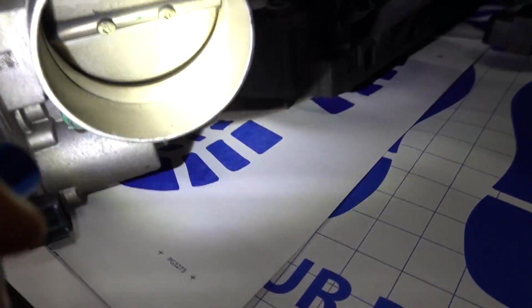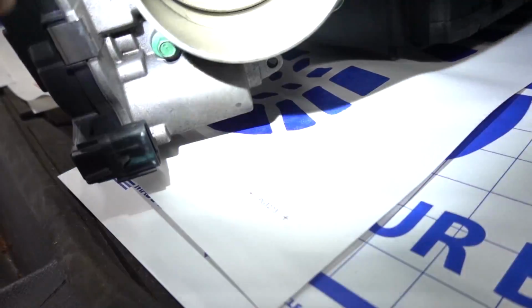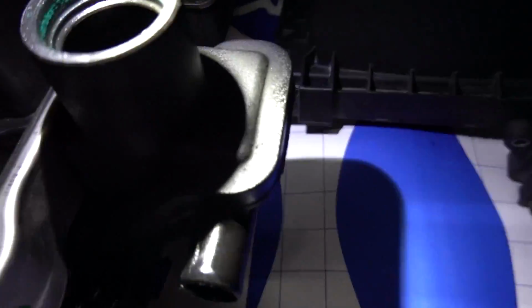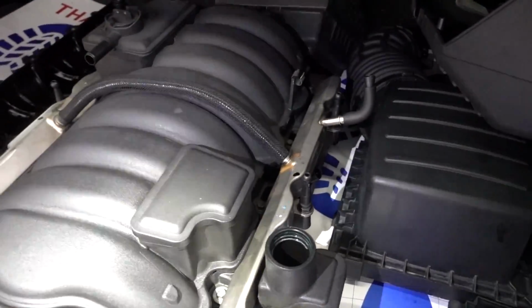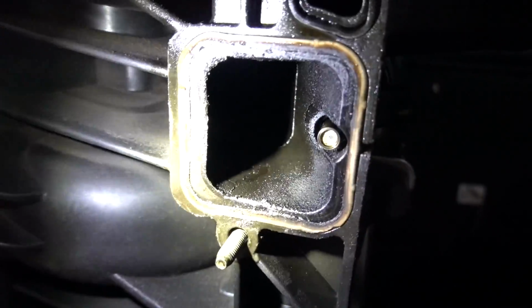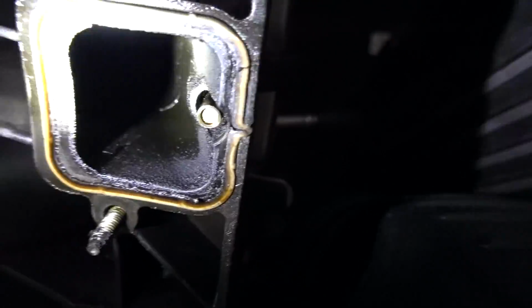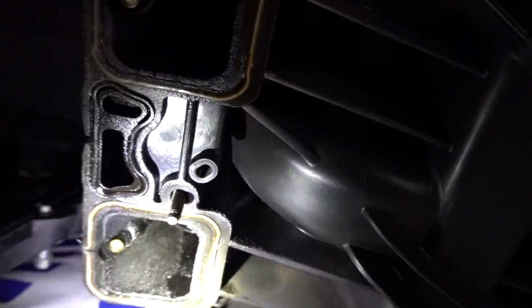And this is the intake manifold. I can't really open that up, but overall, they used the catch can, so this should be pretty clean. Let me see if I can turn it around real quick. I don't know when they added that catch can, but there's definitely some buildup in the intake manifold. You guys can see the oil in there. That's probably why you definitely want to add that. Some of them aren't as bad, but these lower ones are pretty bad. Interesting.